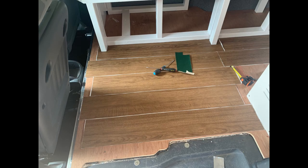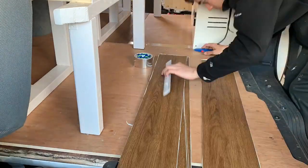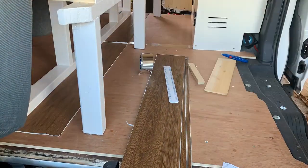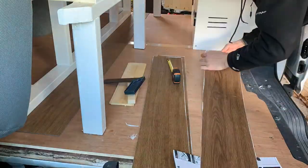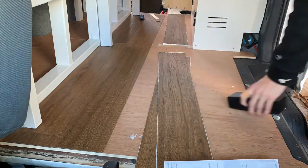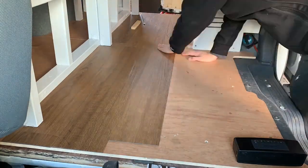These are the self-adhesive vinyl planks I've chosen for the van. They have a piece of film on the back which you peel off and stick down. I've laid them out in an alternate pattern — not flush against each other — so I'll cut bits for the ends to make it look more continuous so you can't see the lines as much. The planks were really easy to lay — I got them from B&Q for around £15. I needed two packs for my van. Alternating the planks so the ends don't align is essential to achieve a seamless look.